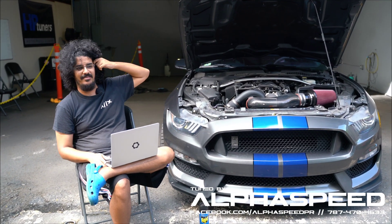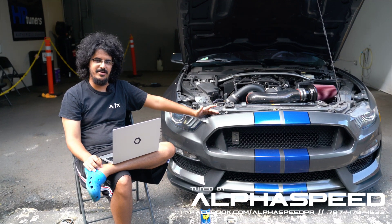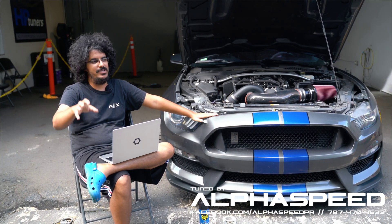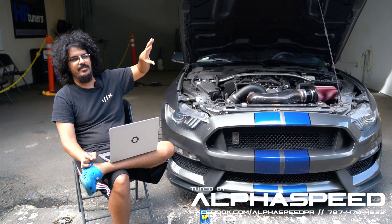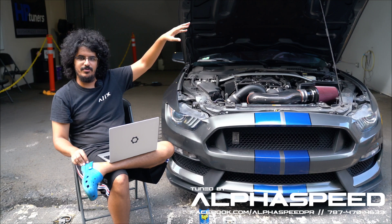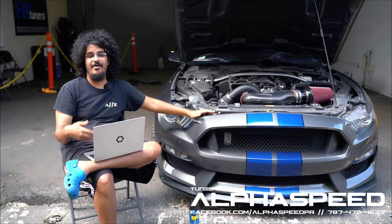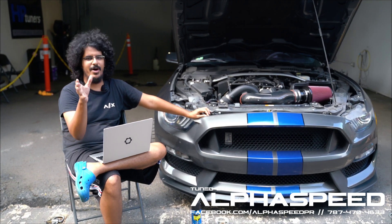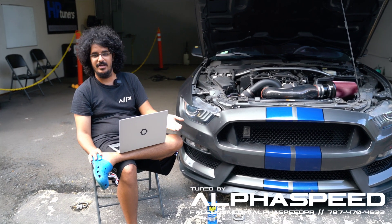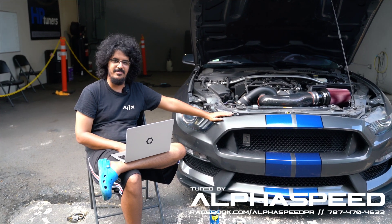These cars have a very advanced and somewhat complicated torque management system, as some of you may know. We made an Excel sheet that does most of these torque table calculations for you. You put the torque table into the Excel sheet, tell it your expected torque — it grabs the highest torque value from the original table — and then you give it your new maximum expected torque value. It converts the old torque table into a new one accounting for whatever new torque you're expecting. You can do this with all 27 tables this system uses to calculate torque, and output a table you can use directly in HP Tuners.